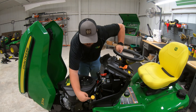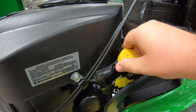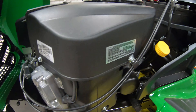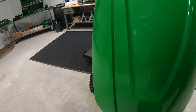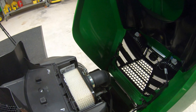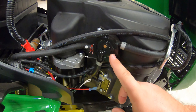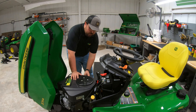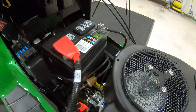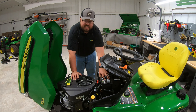Some service points to keep in mind: right here is our oil fill, and right below that is our oil filter. The oil fill is also where our dipstick is so we can check that level. Moving around the side, we have one of our spark plugs at the front. This is a V-twin engine, so you will have two spark plugs — one on each side. At the front of the engine, behind this cover, we have our air filter. Over on the left-hand side we have the fuel pump, which is important to know because swapping it out is often the easiest fix for fuel issues. Right behind the engine is our fuel filter, and then of course we have our battery — very easy access to all of these maintenance points and the battery right here underneath the hood.